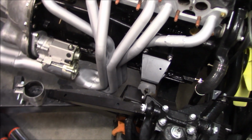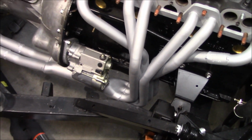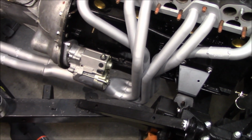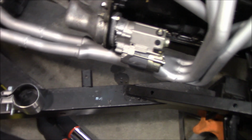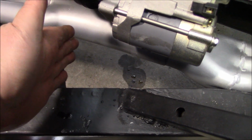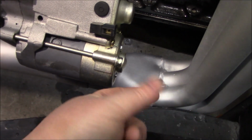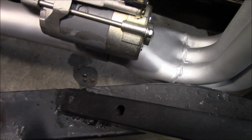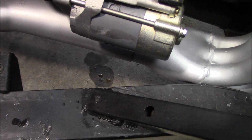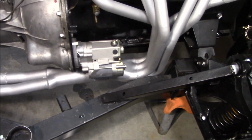what I'm talking about. I'm having a little bit of difficulty visualizing how much space I actually have within the engine bay or compartment to actually put an O2 sensor, where I can put it where the sheet metal is not going to be in the way. I've already determined that I don't have enough room back in here to put the sensor, because I can't put it up on an angle because it'll hit the bodywork or the floor of the car. I can't put it too close to the actual header. It needs to be a specific distance away. So I'm left with a few options for where to put this, and I thought I had put it in a good spot, and I was fairly close, I think, but not quite there.